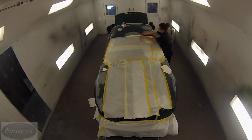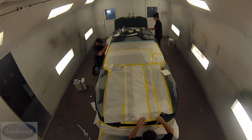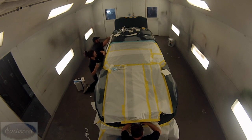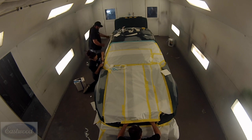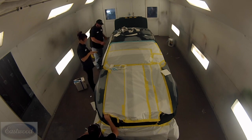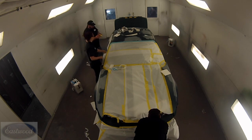That bridging is something you absolutely don't want. If you're doing a restoration and you have the windshield out, that's even better — then you can mask the inside of the flange like we did on a lot of the other places. But we didn't take the windshield out on this project. So we're just finishing getting it masked off. We outlined everything, did the jams, came back and filled in the areas we don't want painted with paper. You want to go around and make sure everything's sealed up, that there are no gaps where paint could get through. You want to make sure it's all tight and not going to get overspray in areas you don't want. We've got a lot of masking products on that roof. We are going to clean this again — it seems like you do the same thing over and over, but if you want a nice clean job, you're going to have to wipe it down a couple of times.